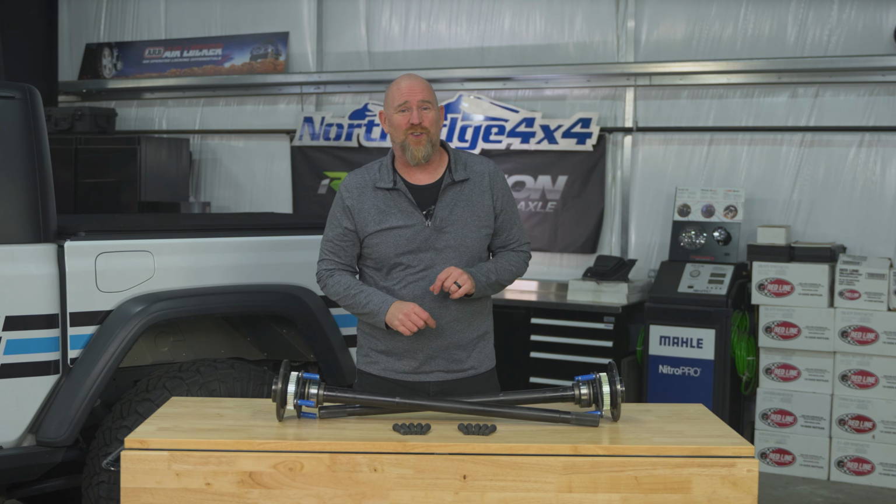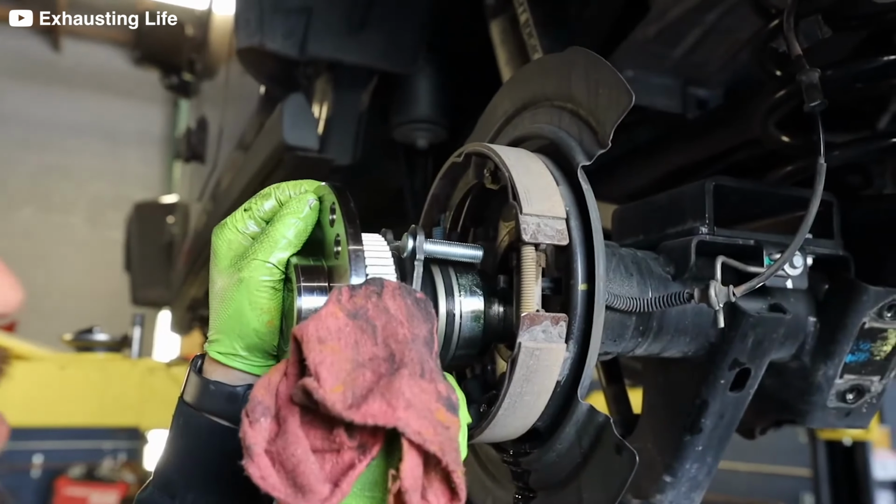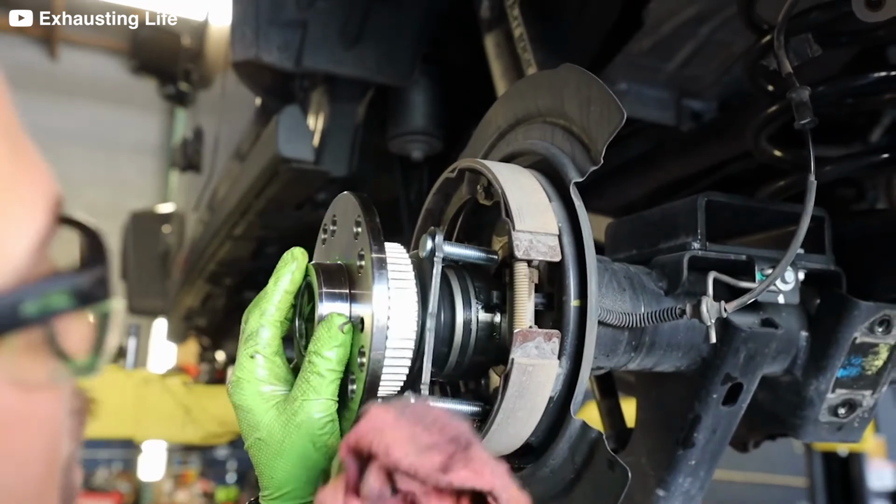Installing this kit is straightforward. It's practically a slide in and go setup, since all the components, that wheel bearing, the axle seal, and that retainer, they're pre-pressed in. And if you've already replaced your wheel seals and bearings, you know how big of a pain in the butt it is to do it separately. With this kit, you're getting fully loaded axles that drop right in. Now, as mentioned earlier, the studs do not come installed on these axles. And yes, that is something you can do yourself.